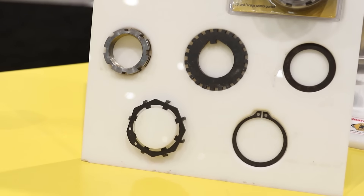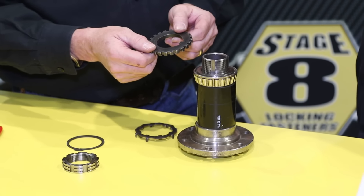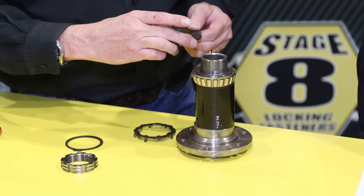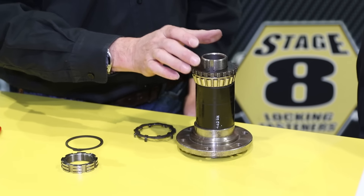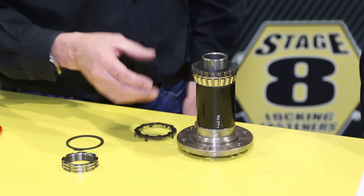So this looks pretty ingenious, but how exactly does it work? We start with a nice thick notched washer — notice how thick it is. That prevents walking on the threads that you can see happen with the original system here. This goes over the keyway on the spindle, and it's 4130 chrome moly and through hardened, so that's a very tough piece of material.